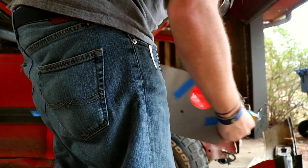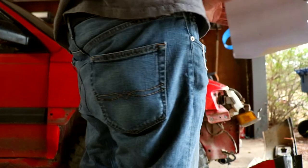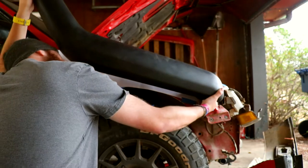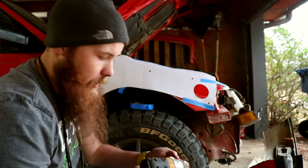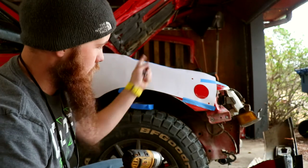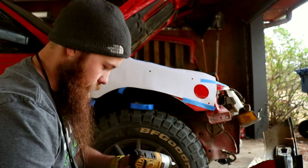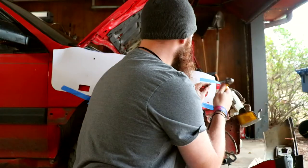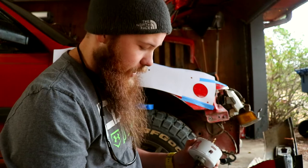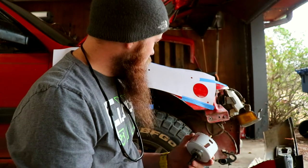It's a reoccurring theme on this channel, but I get things backwards a lot. Now the bolts are aligned correctly. I'm going to put a couple of these fender bolts back in just to hold it, because it's kind of flimsy when you push on it — I'll put one here and a couple up here so when I drill it won't flex so much. I could run a pilot hole in there, but I think I'll be fine. If I feel like it's going to start skating on me, then I'll stop and run a pilot hole.